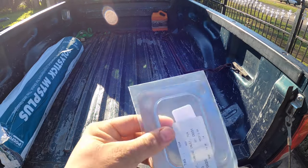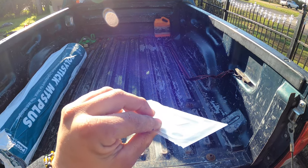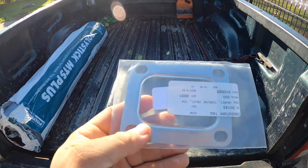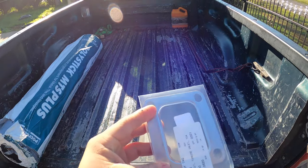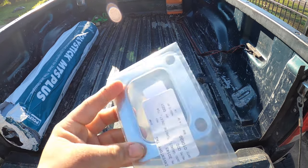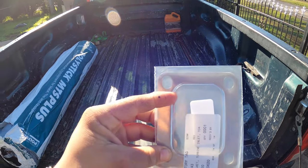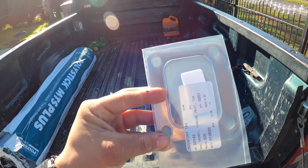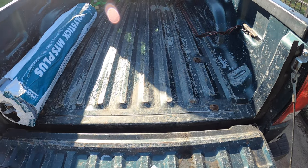It's a gasket — it's made of stainless — so this will sit in between the turbo and the piping, which is the hot side of the turbo. These come in different sizes like every gasket, but the thing with these is that the smaller your turbo is, the smaller the gasket is. So this is a T4; the next one will be a T3, which will be smaller. Then the T2 will be smaller, and smaller as the number goes down, so T1 is basically the smallest gasket you could probably get.